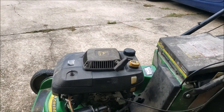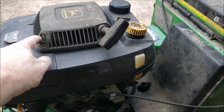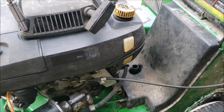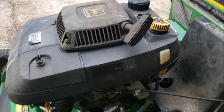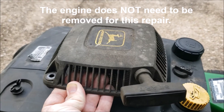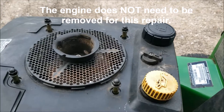I'm recording this by myself, so the video may be a little choppy. I know I'm going to have to remove the cover — this is a 10 millimeter bolt, or 10 millimeter hex I should say — and I'm going to have to stop the crank. After removing the four 10 millimeter nuts, this recoil starter will lift off. You can see I've already done that.